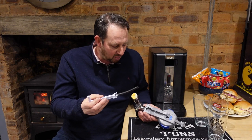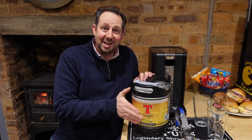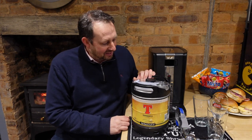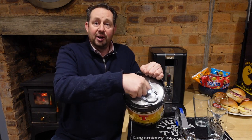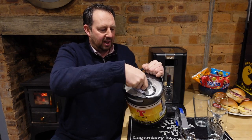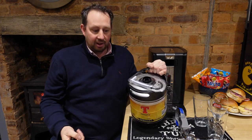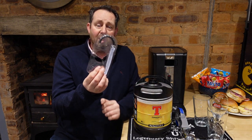I'll just go over the sink and wash this one out and we'll get the new keg on the table. Here it is — to get your beer line off the top, you pull down on the plastic tab, pull that across and out it comes. That's just rubbish — put that to one side. This pops off as well.